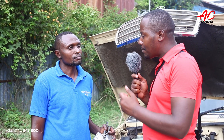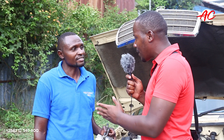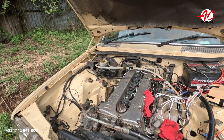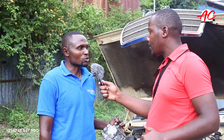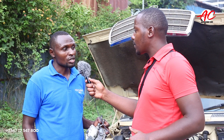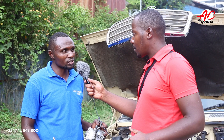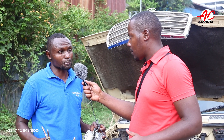You've talked about tuning. Does that mean that immediately after you do the EFI conversion, there is tuning needed? Apart from that, what else is needed? Once you do the swap, the engine runs on the base program — meaning it will allow it to run, but that's it. In terms of fuel efficiency, power and everything, it won't have that. Tuning ensures you have the right fuel at the right time and the right ignition at the right time, so you get power at any given moment. I also tune for drive modes: economy, comfort — which gives you power between economy and sport — and sport, which should give you massive power. All of that needs tuning.